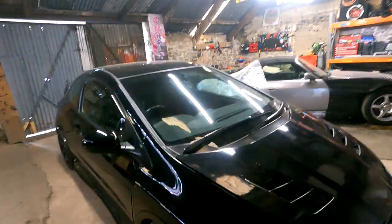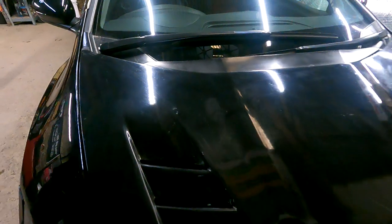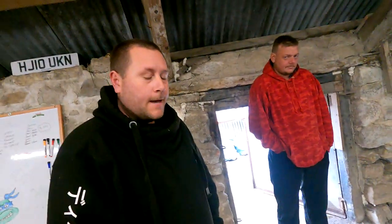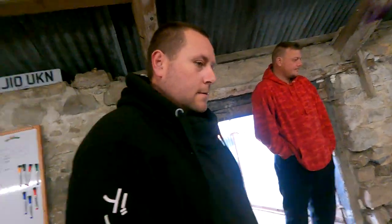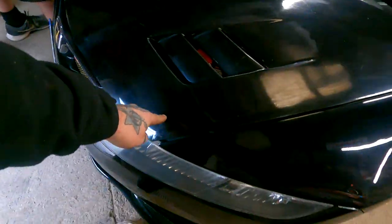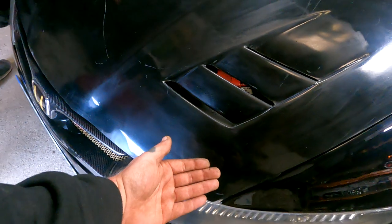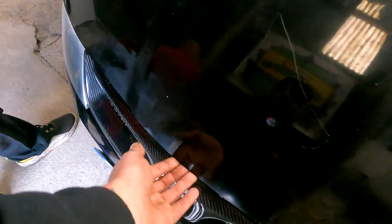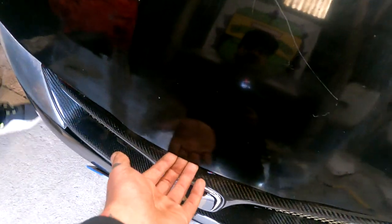Okay, look at it. Obviously it's high here - if you remember the video that we did on the Jay's Racing one that I fitted, it was worse than that and it just randomly settles down. So we'll get it painted, fit it, and then leave it and it should just settle down. There are two little rubber bump stops there that you can make higher or lower.